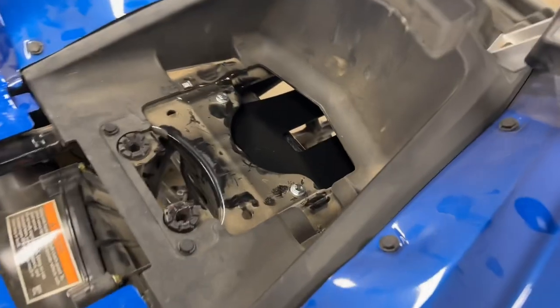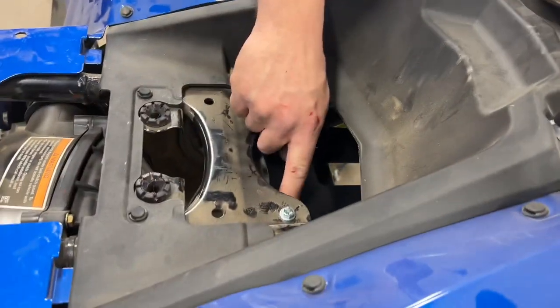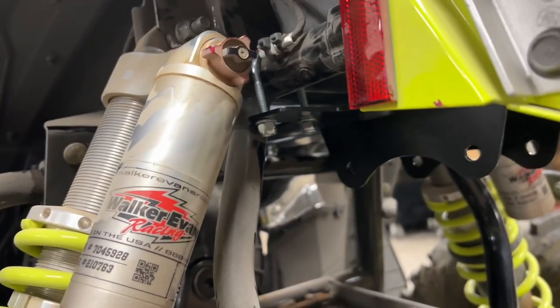All right, well we're at a good starting point, so now it's time to get the exhaust installed. What's up with this top bracket? Basically there's two U-bolts that go on a frame down here, and then up here these work with little spacers — just bolts like that. HMF basically makes you completely remove everything and you're installing a new exhaust hanger. The original bracket is on the bottom right here holding the rubber bushings. The silencers still have rubber on them, which is perfect — you definitely want a rubber-mounted exhaust so you don't get any cracking.